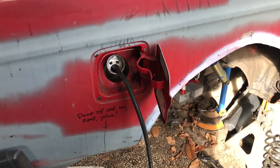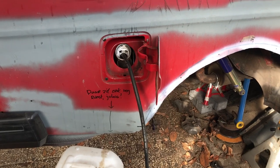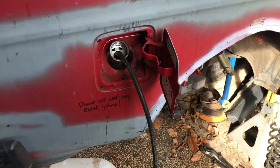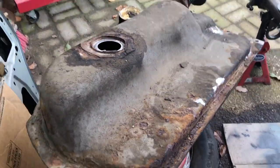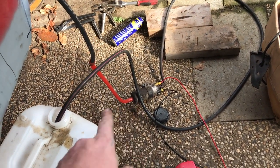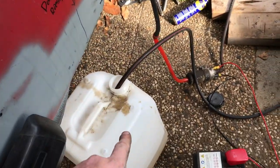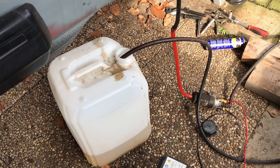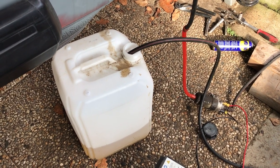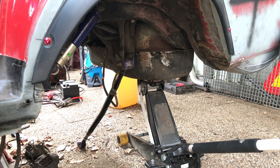Then you can put your jack underneath the tank, finally remove the bolts, and lower it slowly and controlled. I found out there's probably still a lot of fuel in this tank just by feeling how heavy it was when the bolts were almost undone. A busted tank I have here is quite light, so I think there's a lot still in it. So I whipped up an old fuel pump with some hoses, put a hose in the tank, and now I'll wait until this 25-liter canister is filled.